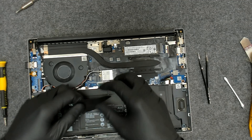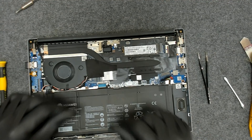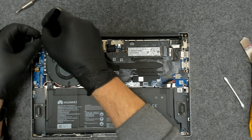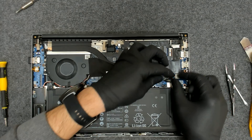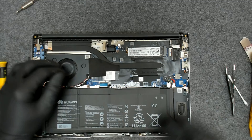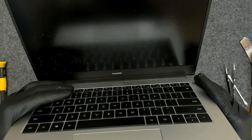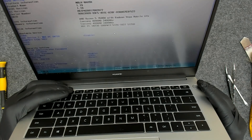Put back the sticker here — I think it was something like that. Now let's connect the battery — slide the back side first and then clip the connector, otherwise you can break the plastic. Let me check — do we have a picture? We have the keyboard backlight. It may take a little while to show the picture because we did disconnect the battery.